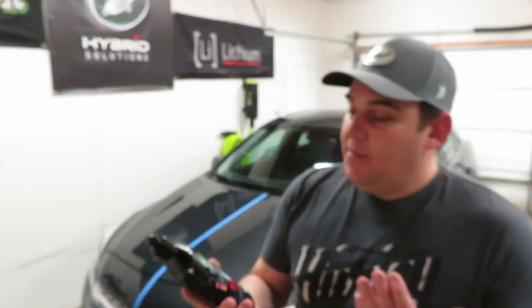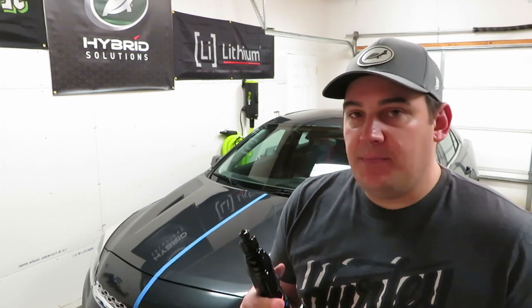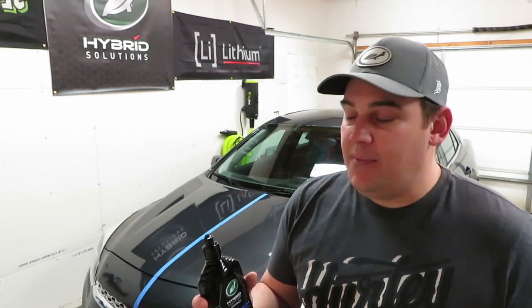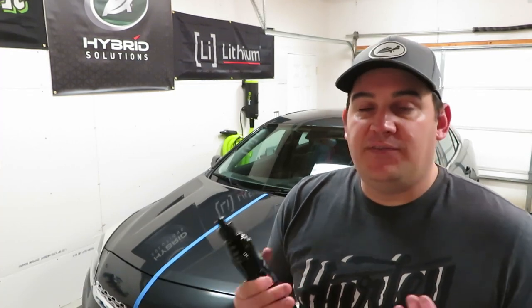Basically, it has precision platelet technology for its abrasives. So its cutting power is all up to you and the pads that you're going to use with this compound. If you want a very light polish, you're going to use a soft wax pad. If you want something that's a heavy cut, you're going to go ahead and use a microfiber or a Euro or a wool pad for that heavy cut. And then for anything in between, you're going to just match your pads for what you need.